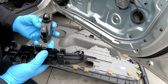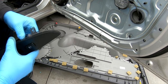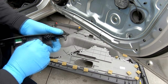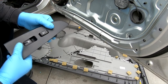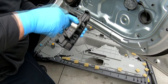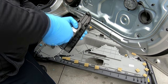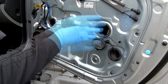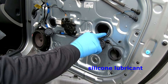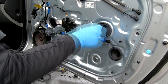Put the switch back into the cover. Not sure it's seated right — actually broke this little piece, but that's alright. Put the two screws back into this cover. It's a good idea, while you're in this area, to go ahead and spray some silicone spray on the tracks of the window — that'll help it slide up and down. While you're in here you might as well do it, give it some lubrication.